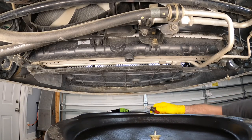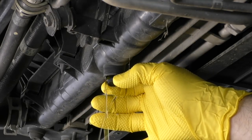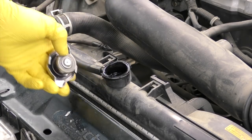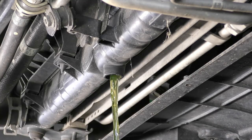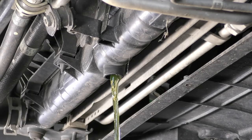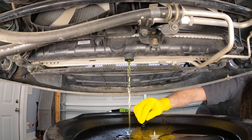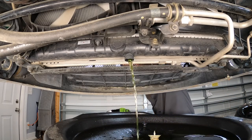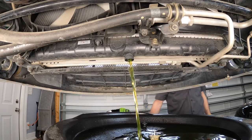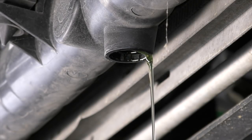Before we work on our coolant, we've got to make sure the system is not hot — when the cooling system is hot it is under pressure, and releasing that pressure will send hot coolant right into your face. Make sure the car has cooled down. Also, remove the radiator cap to help the cooling system drain faster. Because our coolant looked pretty good, we're just going to do a drain and fill. If the coolant was heavily contaminated, we'd flush it with water repeatedly until the water comes out clean. Sometimes we need a little chemical assistance — a product like CLR works really well, or if you had an oil cooler failure, ordinary dish soap works well to get the oil out of the cooling system.